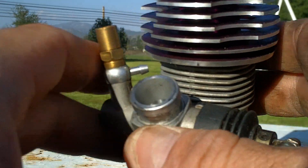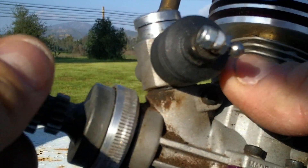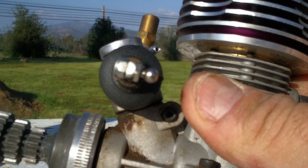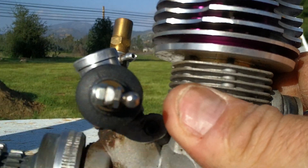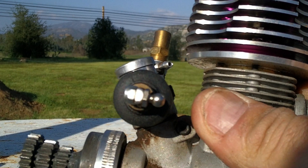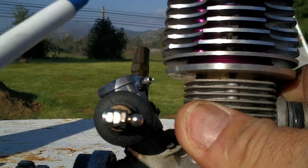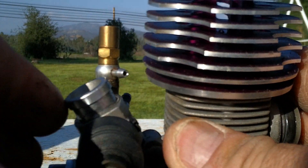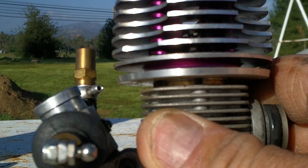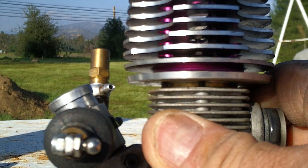This is an ABC engine, which stands for aluminum, brass, chrome, and cylinder liner. The cylinder liner is brass, and the internal surface is plated with chrome. What that does is prolong life and just makes it last longer. Most engines today are ABC. Some are ABN, and the N stands for nickel. The OS engines have nickel — ABN engines — and they're really good.